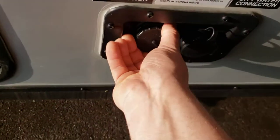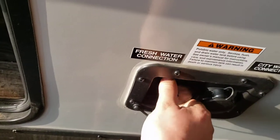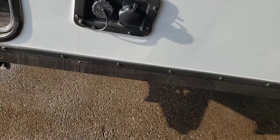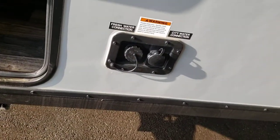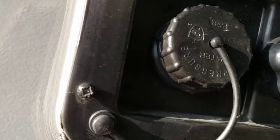Fresh water — this is where your fill hose is stored. Fill your onboard fresh tank, but monitor its progress from the inside rather than waiting until you hear water squirt out everywhere. If anything were to fail, you might accidentally pressurize the fresh tank and it could burst or rupture. It's gravity fill, so pay attention, stay near it until it's full so you can shut the water off right away. Just like your water heater, recommend draining it after every trip — you don't want water sitting in there getting stagnant and smelly. That right there is your drain for the fresh tank.